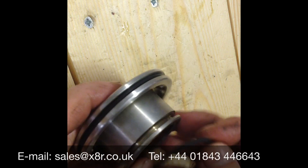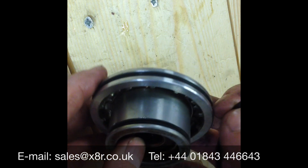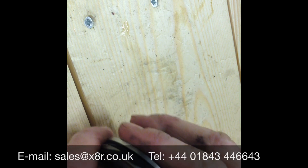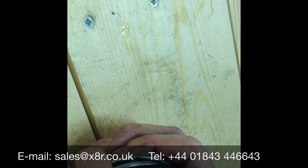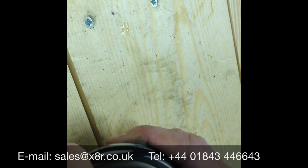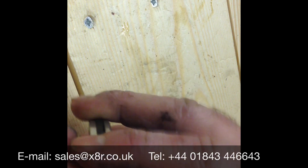Repeat the process with the smaller o-ring in the smaller groove, making sure it's seated in there. Now repeat this process with the outer seals — these are a tight fit. Again, you can warm them up in warm water to make fitting them a little bit easier; remove them a second or so before putting them onto the piston and dry them off first. Make sure the seal is slowly going into position and isn't twisting or binding. You can see it going into the groove nicely — just check it all the way around to make sure it's straight and not twisted at all.